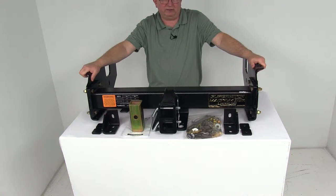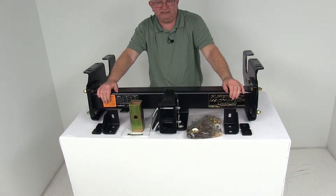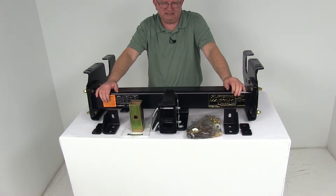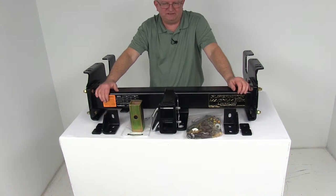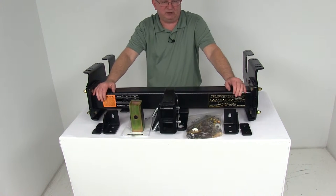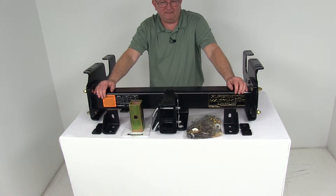This is a heavy duty hitch — it'll let you tow very large loads even when using a Torque Lift Hitch Extension or a weight distribution system. It will max out at a 30,000 pound capacity when used with the Torque Lift Specially Designed Everest Weight Distribution System, which we sell on our website. It is sold separately as part number TLWD1000.